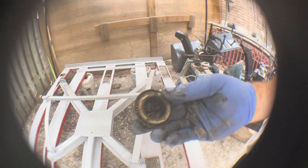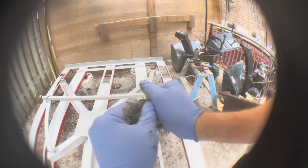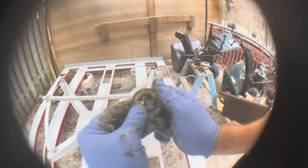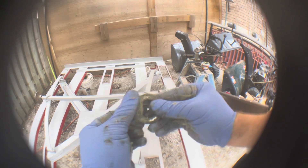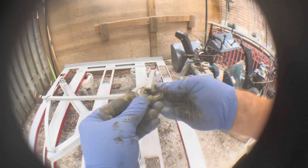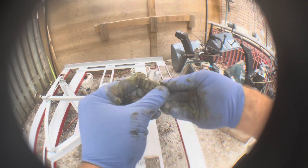So what I was talking about earlier — kneading it. This is a bearing that requires the grease. You just kind of want to squish it in there — that's what I mean by kneading it. Get it all in there into the grooves. You just kind of push it in, so to speak. You want to roll it and then re-knead it all in. Do this a couple of times so that you are fully saturating the bearing with grease.